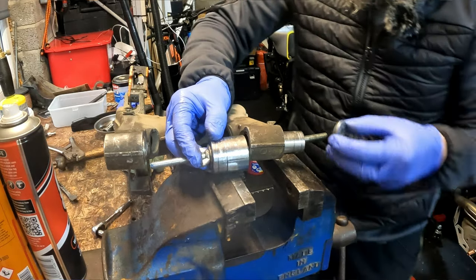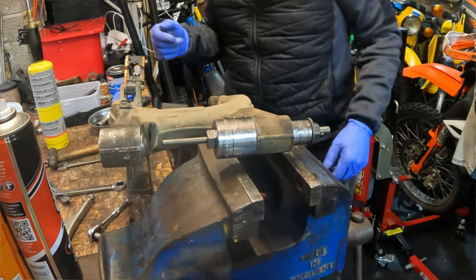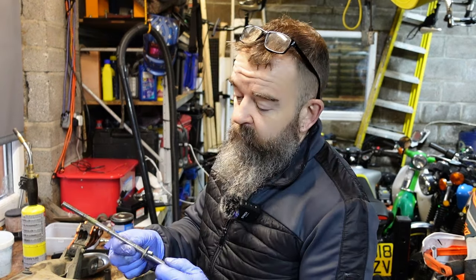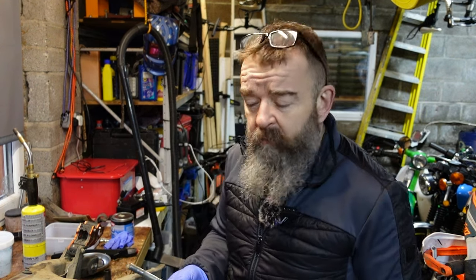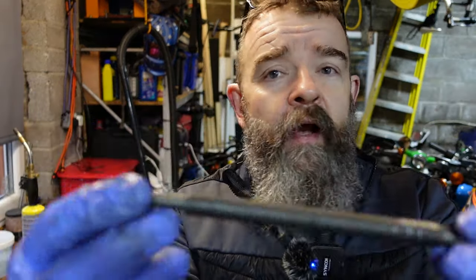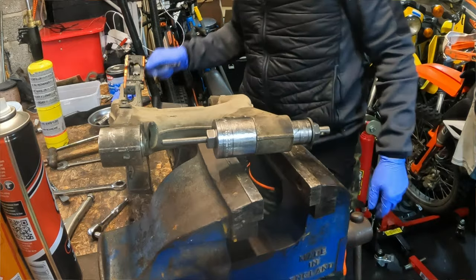We have a couple of washers to stop the nut from going into the socket itself. We've just swapped it a bit because the 10mm, 12mm stud bar's not really up to it for pulling it out. It'll push them back in, but for some reason it just won't pull them out. It just needs that first bit. So this is a bearing removing tool. I've just used that with a couple of sockets. And we've put that on and we're all right.